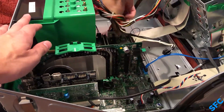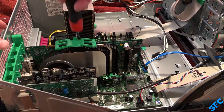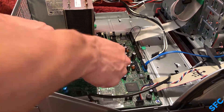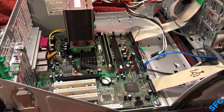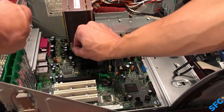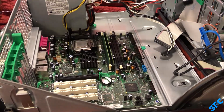I did try other RAM configurations and known good modules, and it seems as though the two right slots are goners. This is not ideal, as dual channel mode will not be possible, but for reasons I cannot fully comprehend, I still want to save this thing. It is nice to at least work with such clean hardware.